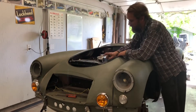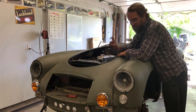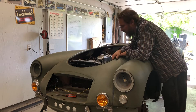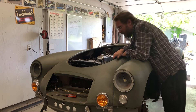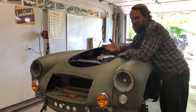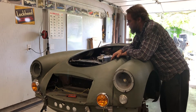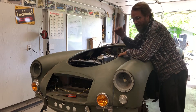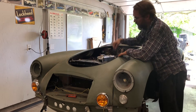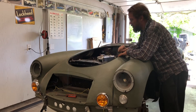Looks like all that was was just dripping out of the overflow a little bit because he had the radiator just a little bit too full. So we go again. I want to keep it up over 1,800 RPMs for about 20 minutes to make sure that the cam is seated in properly. If you don't have it at 1,800 RPMs or higher, then the lifters aren't spinning in the bores and you won't get a good pattern on the cam — you can wipe the cam during initial break-in.